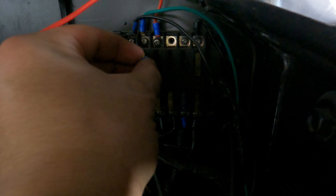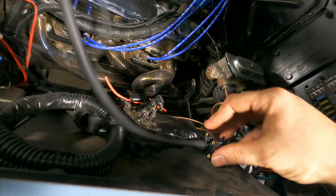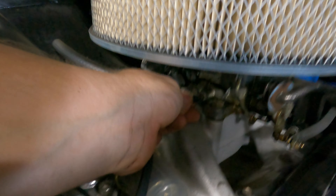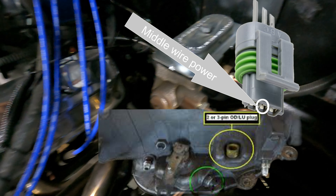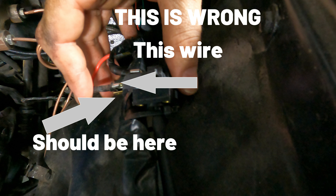Now with the wires on, we can tighten it up. Pop our fuse in — got a 15 amp. Go ahead and loosely route the wire up to the switch, because we still have to run one more wire down to the transmission. Now we can do our vacuum line to our pressure switch. I'm going to route it along here, down on this loom and straight to the bottom of the carburetor. Plug it in right there. Now I've got the power wire that goes to the middle wire on the harness, and I'm going to go ahead and feed it down.